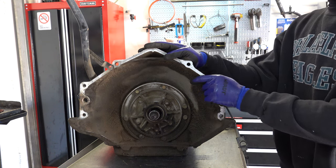All right, we'll dig into these two drums in a little bit. Okay, bands. Again, for high performance, you want to use a wide 2/4 band, especially if you're replacing the drum or machining the existing drum. A lot of times I'll machine the existing drum if there's nothing wrong with it, so that I can set band clearance exactly how I want it, and I know I could dial it in basically perfect. I've got a separate video on ideal band clearance using a 4L60E, but the same principles will apply here with the 700R4.